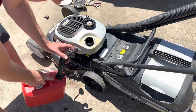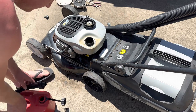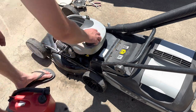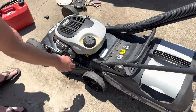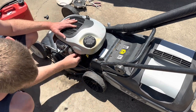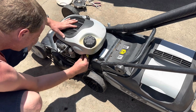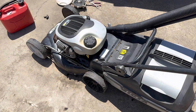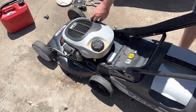I've got to replace this back wheel still. The hubcap just would not snap onto it. It's shot. Anyhow, for now it still goes round and round, so that's the main thing. Hopefully it was just a little bit of crud stuck in the needle causing it to flood. Let's see what this thing does. Still got to reattach that mulching plug mount too, just with a couple of rivets. Hopefully this thing's got some fuel flow. Put him on run. Nothing.